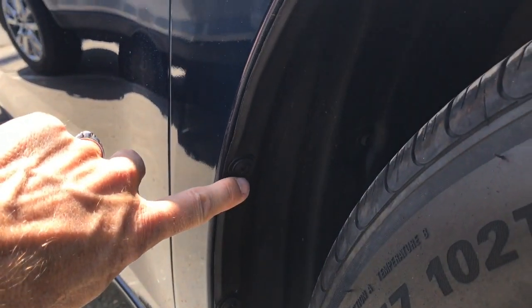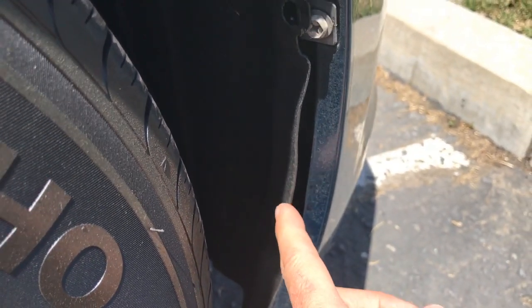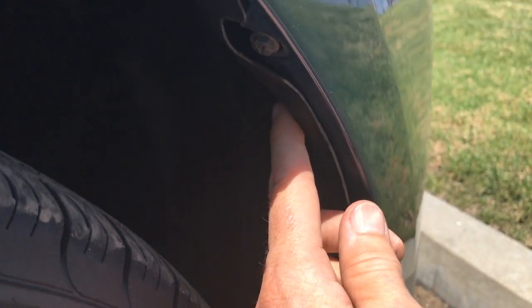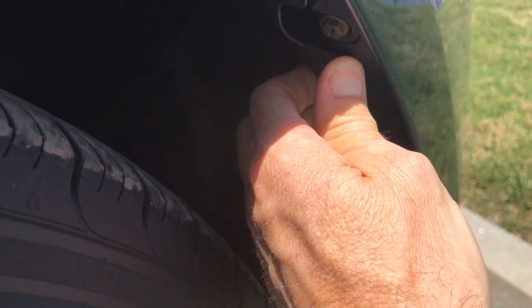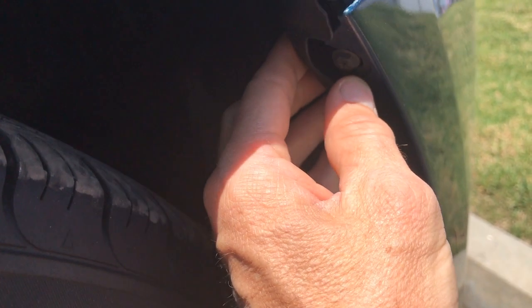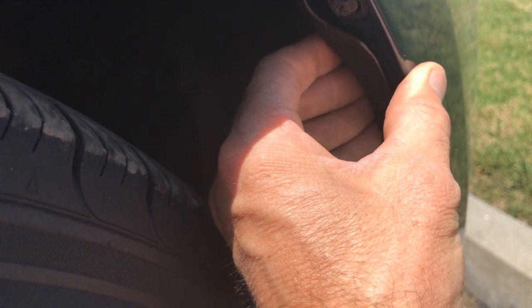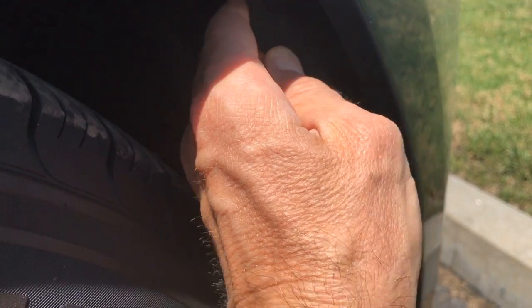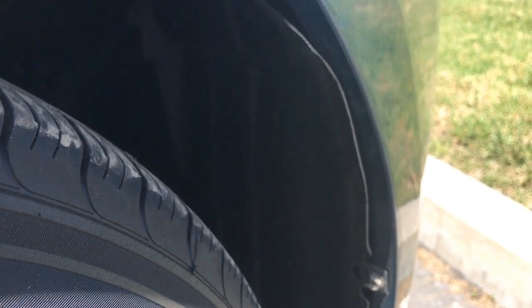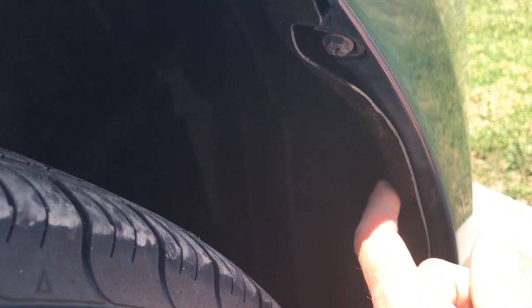On this side I don't see any surprises, but when I get over here, there's all kinds of surprises. You can just see how this has been torn up. This is really quite typical of a repair — they don't take the time to put it all back together nicely. And that makes you question whether they took the time to actually restuff the airbags. You don't want anybody cutting corners, and if they're cutting corners on something as simple as this, it makes you wonder whether they're truly doing a good job in other areas of the repair.